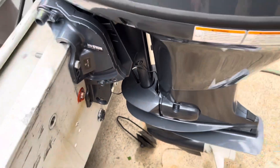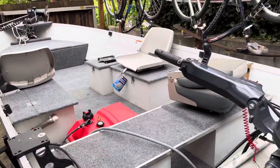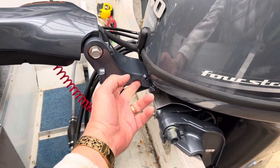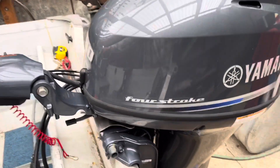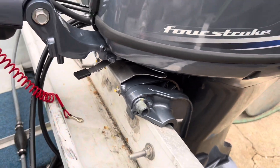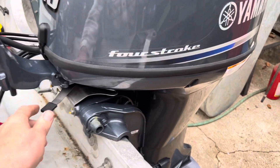When you put the motor in, there's a little plate here — two bolts come out of here that the tiller handle mounts on — and there's a little steel plate that comes with this to keep the motor from turning in the crate. Just unbolt that and take it off. Please leave this other piece on here — you need this. It looked to me like it was a separate packing piece, but this is for tightening up the tension on the motor.